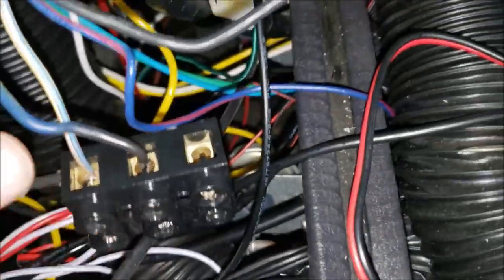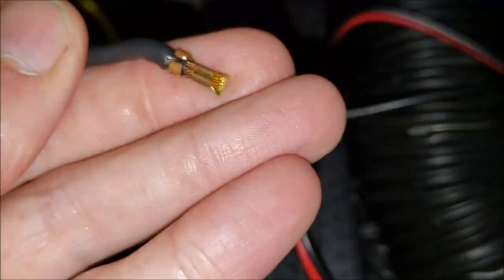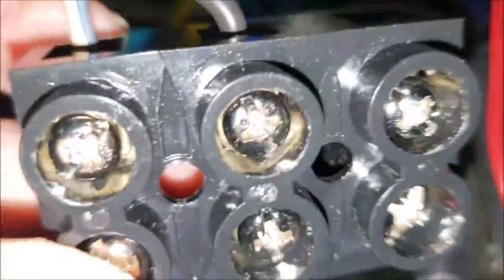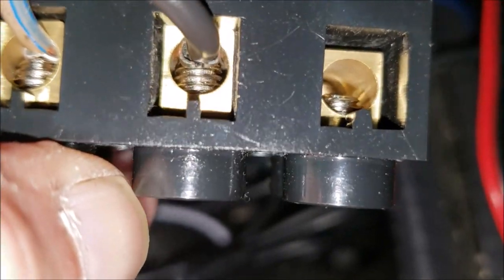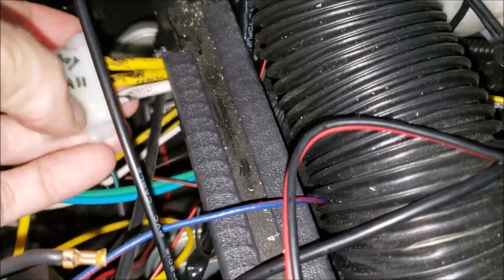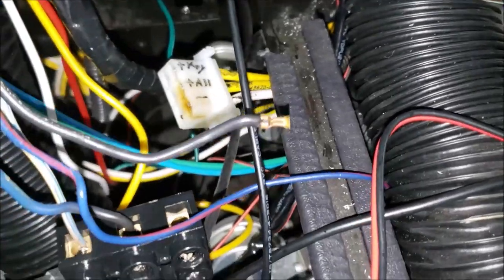I think you get the idea of what I'm doing. On this other wire, I cut the flat spade off of it and left the factory crimp — just like I did on the middle wire — then cranked that screw down good and tight. I really like how this connector block is made; I'll put a link in the video notes because it's very high quality and you can really crank down good and tight on it. The white wire is your ground, and then we've got two hots coming in: one fused from the firewall, one fused from the dash panel. It's odd, but that's the way they did it.